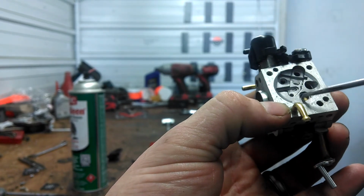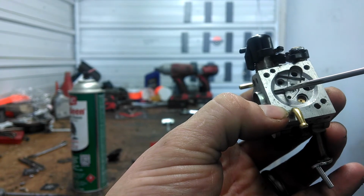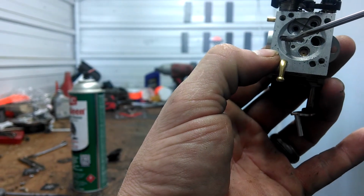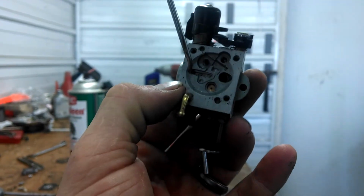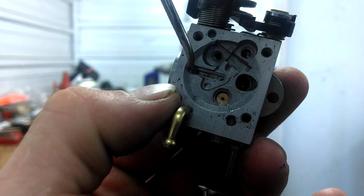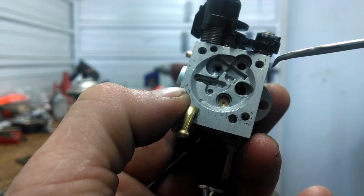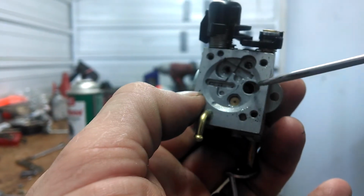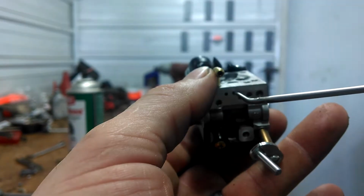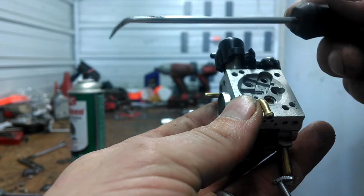That passage goes straight underneath this Welch plug. There is a tiny jet, and that's where the low idle circuit and the transitions are. You can see, hopefully, there's 3 of them. That is the one that is open right there when the throttle is closed completely. And then as you open the throttle, it transitions to 2 open, to 3 open. By that point, you've got enough low pressure going over the nozzle, which is obviously pulled out of this carb body, and that opens up the main jet nozzle, allowing flow to run through the high side. By that time, the computer already knows that the throttle is cracked wide open and the microprocessor is delivering fuel as if it is at wide open throttle.